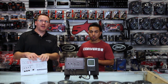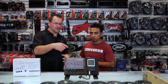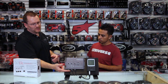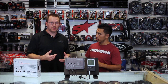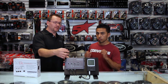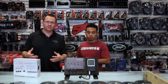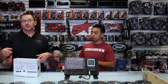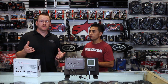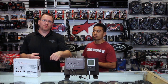It also has the GTO signal sense turn-on. Because it's powered, once it sees the factory speaker signal come in, it'll automatically send a remote turn-on out to the amplifier — that way you don't have to go hunting through your dash to find an accessory wire. If for some reason that doesn't work, you can tie an accessory in and it will still give you your remote out.